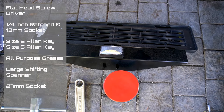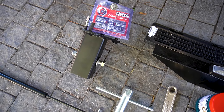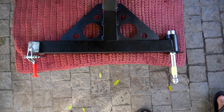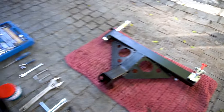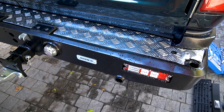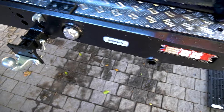With the kit you also receive a number plate holder for instances where your number plate is hidden by the spare wheel carrier and wheel and tire. You also get the actual mounting piece for your spare wheel, a gas strut to assist in opening your swing arm, and the swing arm itself with its spindle and latch. There are also a hard stopper and a catch for the throw-over latch. These parts are supposedly able to be installed after the bumper is already fitted, though I find that would be near impossible, so I suggest installing these two components while the bumper is still off the car.